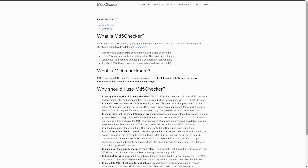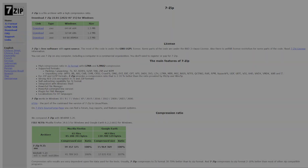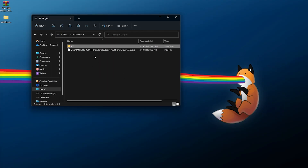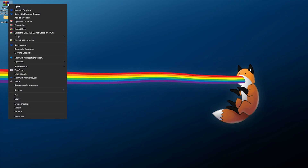Once you've selected and downloaded your firmware, I would recommend checking the MD5 hash. You can use whichever program you'd like — I'm going to be using MD5 Checker. If you also need something to extract the archive, I'd recommend 7-Zip; it's free and easy to use. With your USB drive plugged in, make sure it has been formatted to the FAT32 file system and is set to MBR, not GPT. Go ahead and delete any old firmware update on the drive and prepare it for the new one.